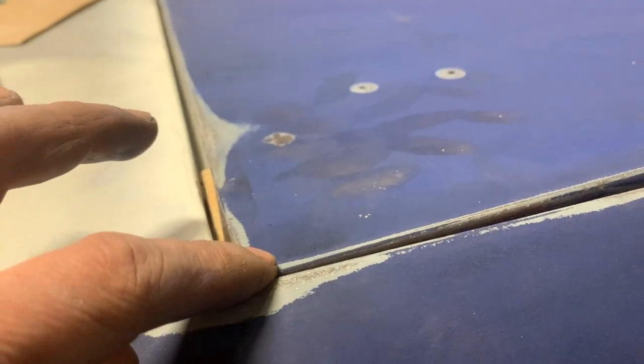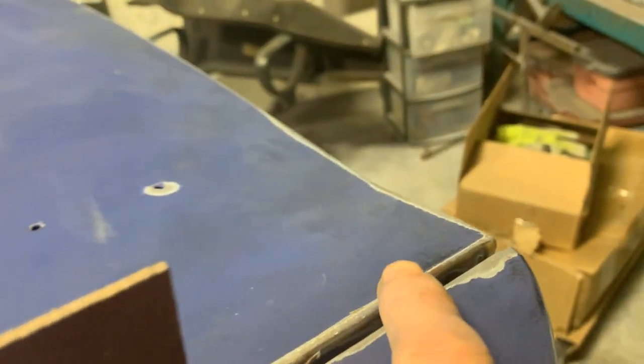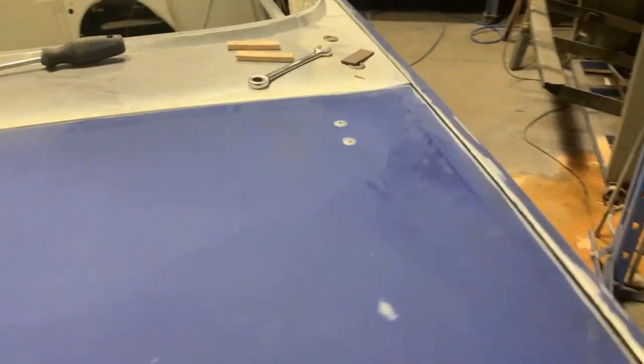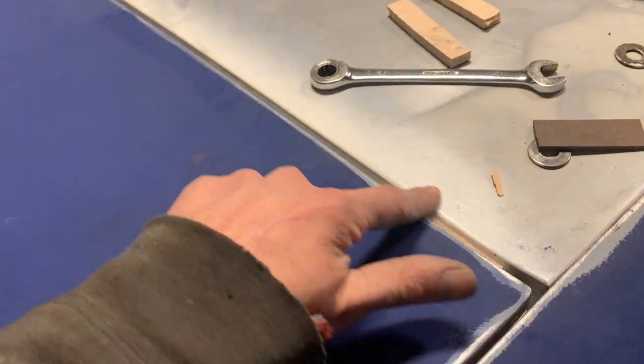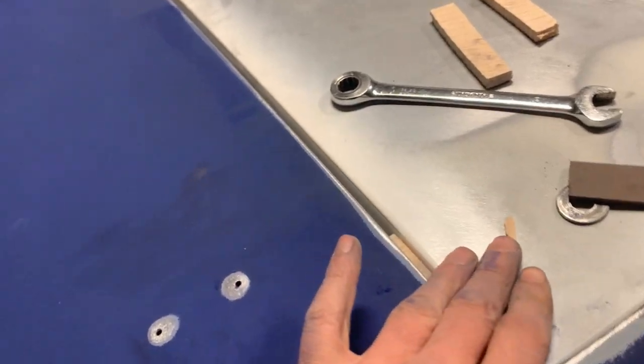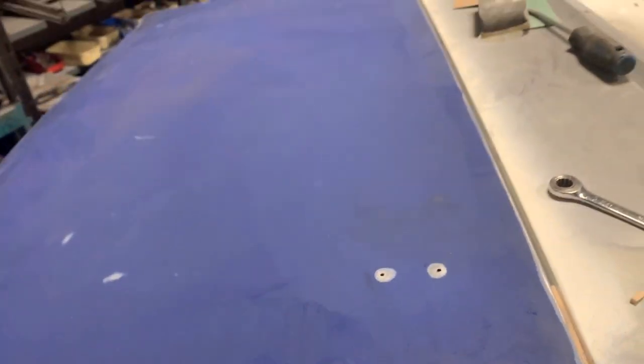There are a lot of holes here. I only don't like this part here because you can see the lid is lower than the fender, then it goes much higher, and then it goes the same height as the fender again. That worries me a little, but I think we can fasten the hinges properly and then maybe we can make some relief cuts on the flange of the lid and bend it a little — I've done that before. Also, here it seems like I made this a little bit too low when I repaired this, so I might need to build it up a little bit only here. Let me tighten them and we'll see.